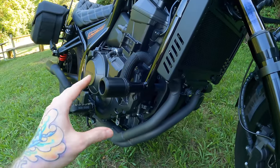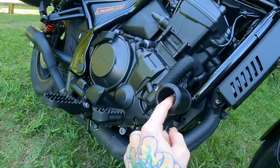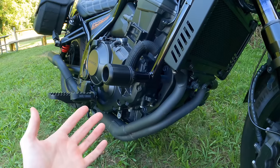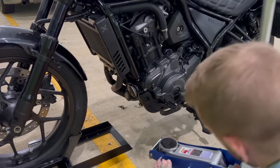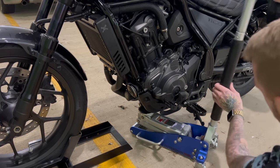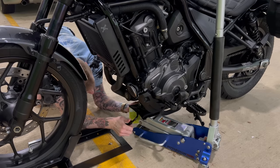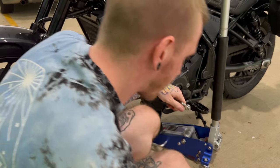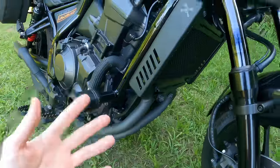Another reason I got the sliders — part of the plan for Rebel 1100 version 2.1 — is to use the mounting point to add some bright yellow fog lights. The headlight really lacks at night because the sharp cutoff line means light hits where you're not looking on turns, so I need some bright fog lights. As for install, it was super simple — done within 15 minutes thanks to Gus from On The Rebel 11 and his install video. The bolt for the sliders is the same bolt that holds the engine up, so you support the engine with an air shim and a jack under the oil pan, pump up the shim, lift slightly, slide the stock bar out, align the new bar, use a rubber mallet to drive it in, and torque to 32 foot-pounds.